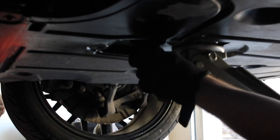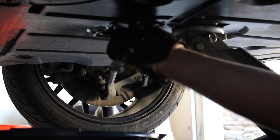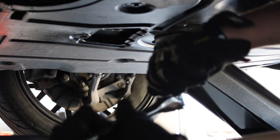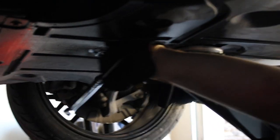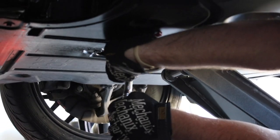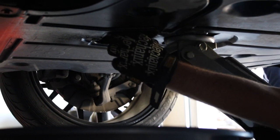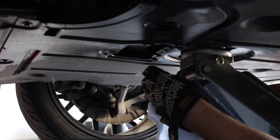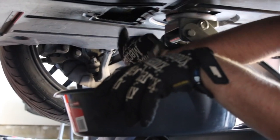There's a little flap right here - you kick the flap down and then there's your drain plug right here. The socket we were using was too small so we dropped it about two sizes. Make sure when it's loose you have the oil pan under it. It's gonna pour all over the jack stand but that doesn't matter - we don't want it on the floor.